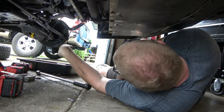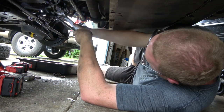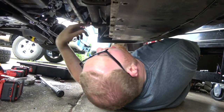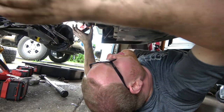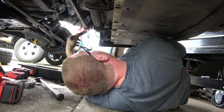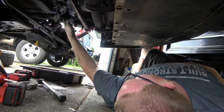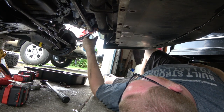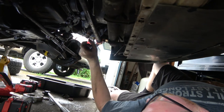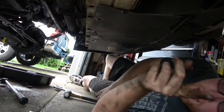I need to bring this down and knock it out of the way. The steering box should come out. If I have to, we can undo the fasteners for the sway bar and just drop it down — it's not a big deal, I just would like it to be one less thing. I was able to crack the power steering lines loose up there. I'm going to go up and finish doing that, get that little bolt out, and then we've got three bolts on the side of the frame to undo. There's one that's behind some plastic — I think I'm just going to cut the plastic to get it out of the way. Then we should be able to get this hunk of crap out and get our new one in.